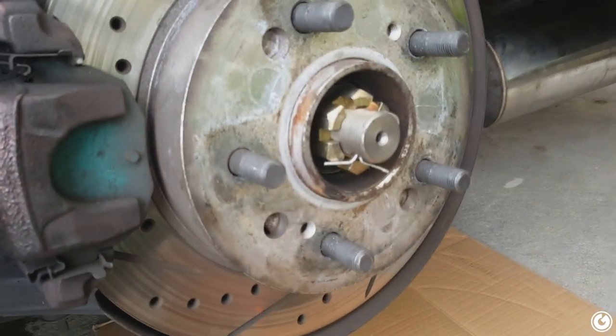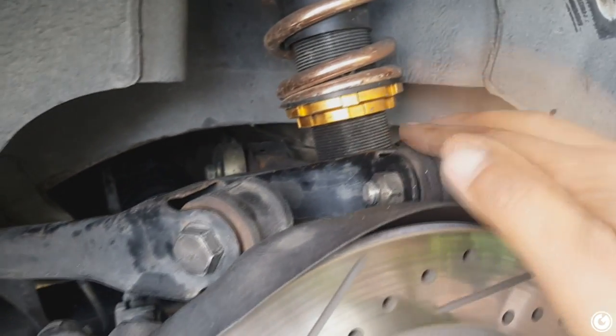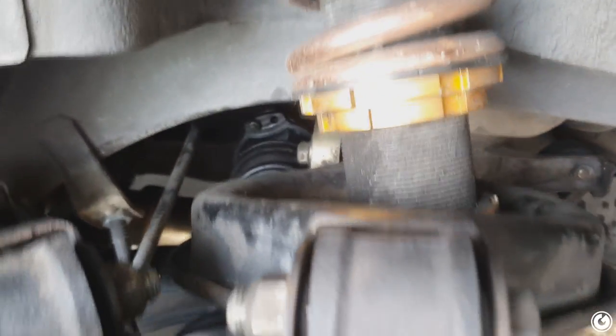Like I said in the last video, you're going to have to take off the cotter pin and the castle nut. You also have to take off all the upper arms — those are all 19mm, there are three of them — and then take off the bottom mount for the coil, which is a 17mm. This is the new axle, completely fine, but it needs to come out.